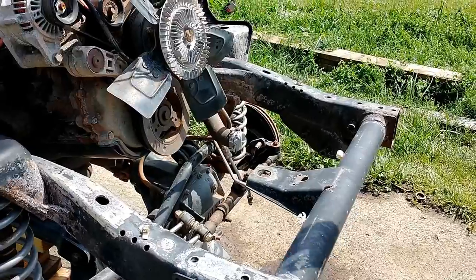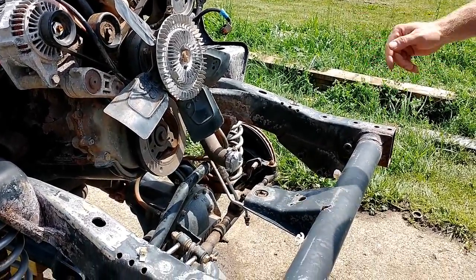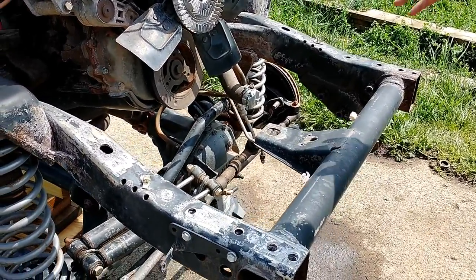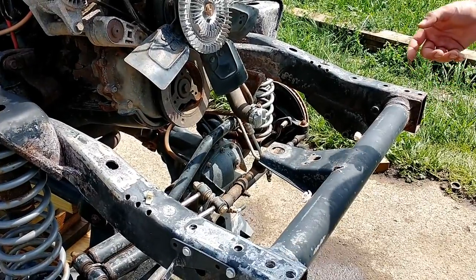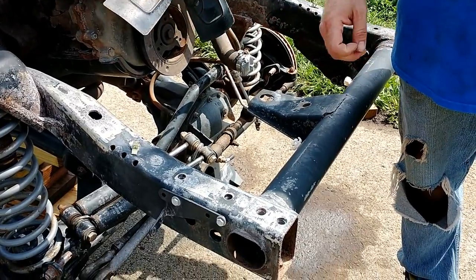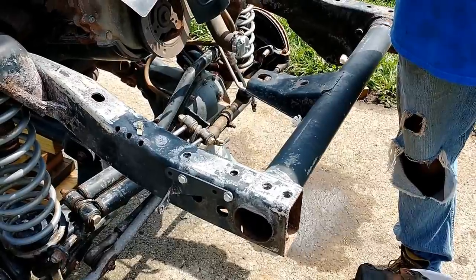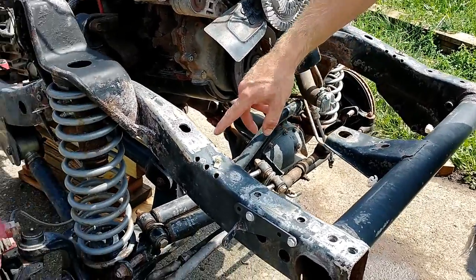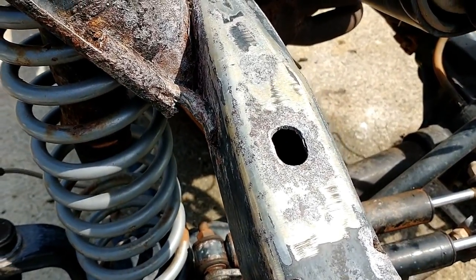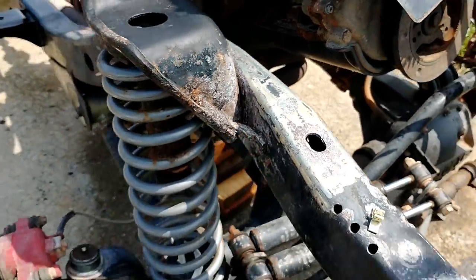But as you can see, I did do the first step, which was a cleaner degreaser, and it gets the metal all ready for it. And then there's a metal prep, and what that is, you spray it on and you keep the metal wet for 20 minutes. And what it's doing is it's actually turning the rusty stuff and the bare metal into a form of like a zinc coating, so that the POR will stick better. You can see here, that is not what it looked like before, but that is the result of the metal prep. So now I'm just waiting for the frame to dry.